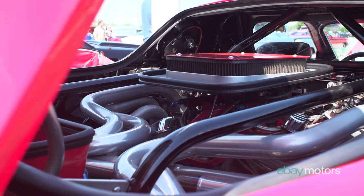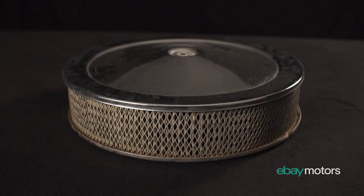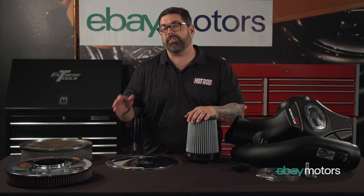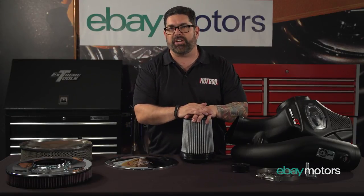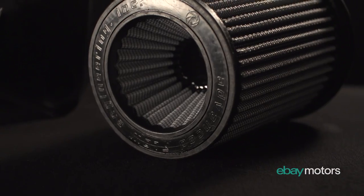Now you have three basic materials for air cleaners in modern cars. You still have that traditional air cleaner on your old Chevy that uses a round paper filter and can be replaced at will. You also have foam and cotton, which can both be washed or replaced because they last longer — a little better material — and their filtration is better when it comes down to what they're actually keeping out of your engine.